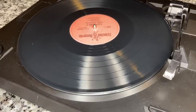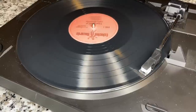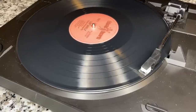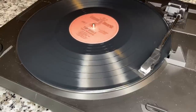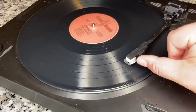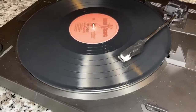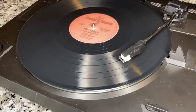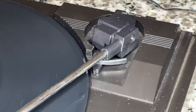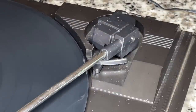Now that we've solved that mystery, I'm going to hit start — that's all warmed up, now it's going to work. So we should be able to actually hear some music now. Here we go. [Music plays] — 'When the only sound in the empty street is the heavy tread of the heavy feet.' Sounds good. So if we want to cue a different song up, we can hit the cueing button. And when I said earlier that there was no cueing lever — we don't need it, because you've got the cueing switch on the front. That was dumb on my part. That descent is pretty quick — it just falls pretty heavy. Not unheard of for these automatics. I did a video a couple of months ago on adding damping fluid to the little piston shaft underneath this lift shelf — very easy, very quick, fairly affordable thing to do.